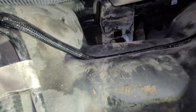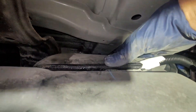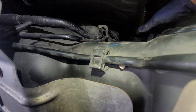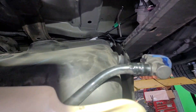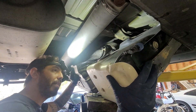Just in case you're wondering, that's how it should look. Make sure there will be some spots where they need to be clipped in. Pretty much it was just a little fast clip, and then this little piece that clips them in. We lubed up this nipple, but we also have to lube up that nipple — that's for the fuel line. Now we're going to go ahead and lift back up the tank. I don't have that much gas so I'll just finesse this in — we just need to push up our heat shield.